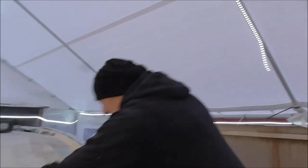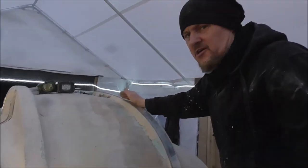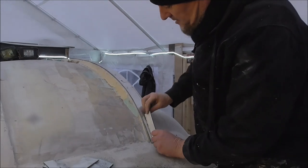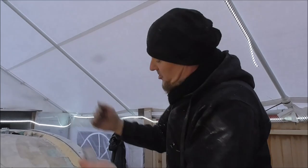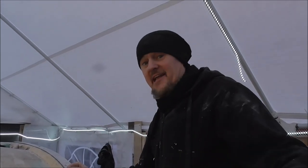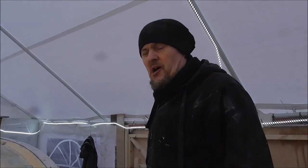I thought I could bring the piece of aluminium to this side but it just follows both sides, so it gains me nothing. What I'm going to do is put this piece of dibond on, and with bondo filler I'm gonna stick loads of these on edge all the way along it. That'll give it triangulation - like a T-section - and then that'll dry. I'll be able to move it across and have exactly the same shape on both sides. The front of the truck has got to be spot on.